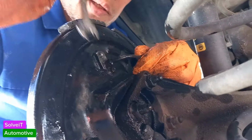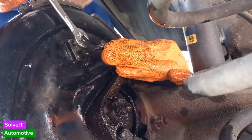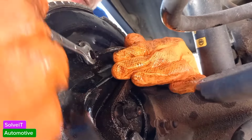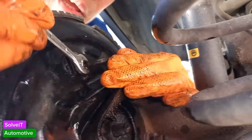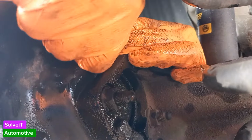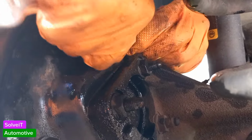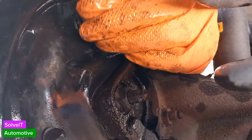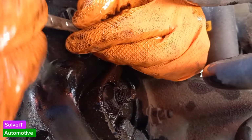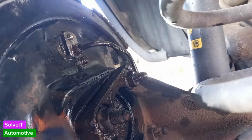What you want to do is turn the pipe fitting by hand, and once it's in, then turn it tight. What's very important, guys, is to manipulate this pipe as you're turning it, because you don't want to cross-thread that fitting, because then you're going to have more issues. So just carefully, gently, don't force it. Make sure you've got play on your pipes. If I move the pipe up and down like this, I can feel that I can turn him even more by hand, and that's what you really want, because you'll go a little bit faster, and then we can tighten him further. And there we go, he's tight. Now we're just going to tighten him up, approximately 8 newton meters to tighten that one. Then we're going to bring in our new nipple.